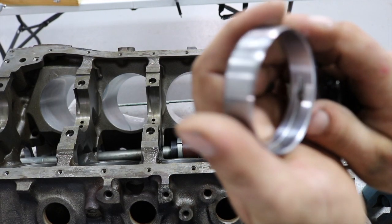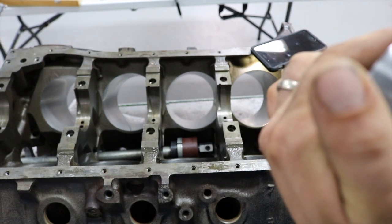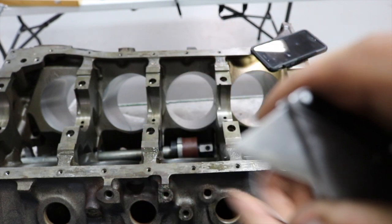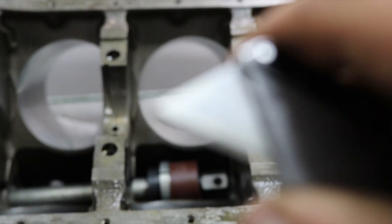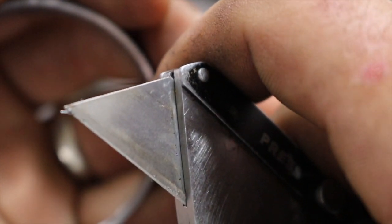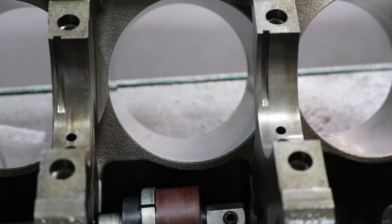Take a razor knife and cut that right out — doing it right over my freshly cleaned engine. That's good — it's a little piece of metal there, probably not ideal to run through your engine. This thing's got bigger problems though. I'm going to deburr the oil hole and install the last cam bearing. The cam bearing bores — the shells actually measure one-and-a-half to two thousandths oversize.